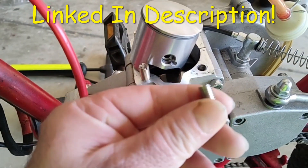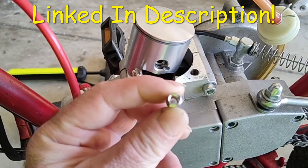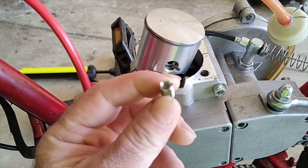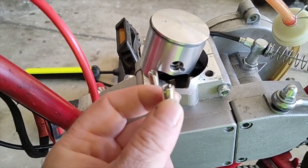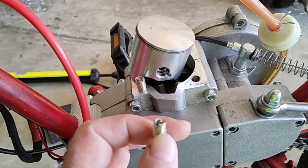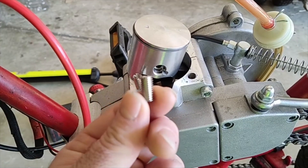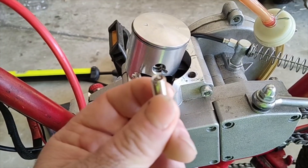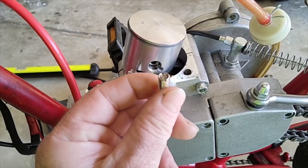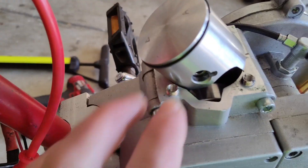These are 15 millimeters long, 8 millimeters outside diameter, and 6 millimeter inside diameter. This is how we're going to adapt our studs for the minarelli build. These are made out of stainless steel — these are not those helical inserts you use for stripped threads. Just don't cheap out, use these.